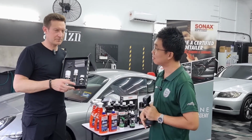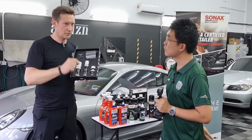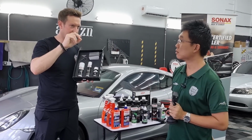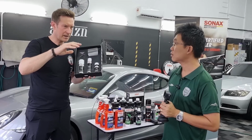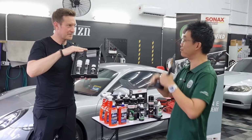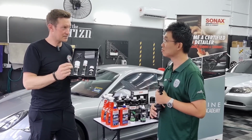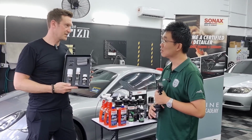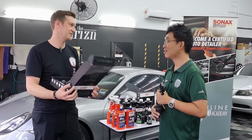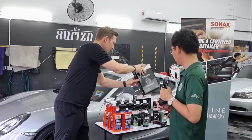There are some exceptions. There are hard clear coats from Mercedes, for instance, ceramic clear coats, but not the whole layer is that hard. There is a polymer layer which is flexible. The hard particles are embedded in the flexible layer, so that's why it's still flexible but hard. Because there's a flexible layer sandwiched in between, so it gives that wiggle room. But it can also not protect against scratches and stone chips. It's maybe a bit more scratch resistant than other clear coats, but not 100% scratch resistant. There's no such thing as 100% scratch resistant, isn't it? The only thing that makes the paint scratch resistant is a PPF. But even a PPF you can scratch. Correct. Anyway, it protects the original paint against scratches.